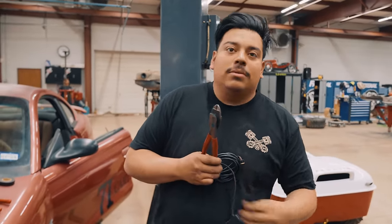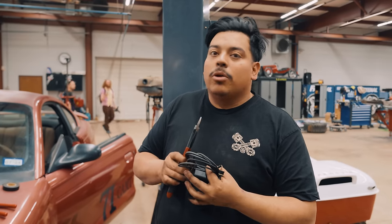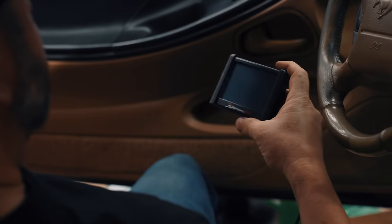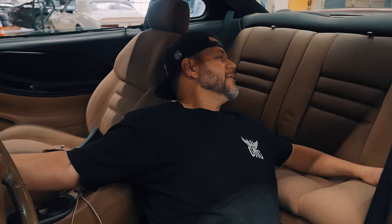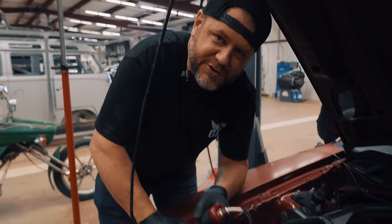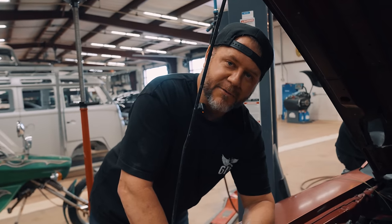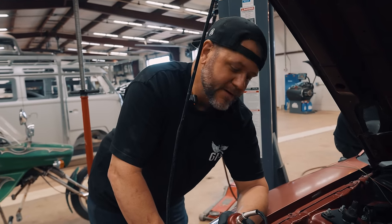One of the last little pieces of the puzzle that makes the Holley system nice and simple is this handheld controller — you can do a lot of the basic setup right here to get this thing off and running. Handheld's on, it's flashing. We're going to get it close and then use the timing light. Sweet, there we go — I love it when we make a whole bunch of electrical connections and then everything works. We're verifying the timing — telling the handheld what our timing is, and we want to verify with the engine and distributor that it matches what we're telling the computer.